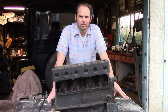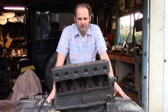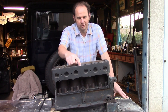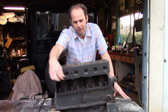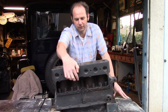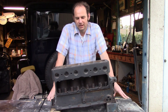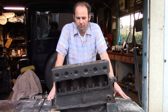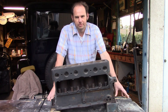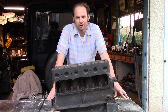Typically with most modern engines there's a way of turning the oil pump without turning the engine, but that's not the case with this one. An old trick that a lot of people use is to remove the distributor — that leaves an open hole all the way down to the oil gallery — and then you can pour a quart of oil down there, which will fill up the center and rear sections. A quart is probably a little too much, but you can't put too much in; it'll just run out the overflow tube and back into the pan. The only problem is it doesn't pre-lube the front main, but that's the first to get oil when the pump starts turning, so we can get away with that.